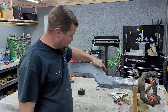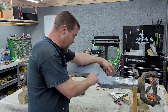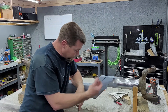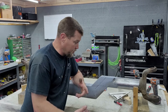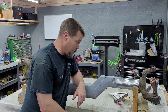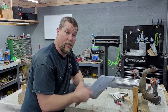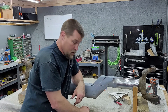If not, I'll make a new piece. It would be really nice if this would just fit like that and I can put a cap back over it. I'm not super thrilled about this because I had it the way that I wanted. I've built a lot of vehicles and this is the first time I've really run into everything being off-center like that. So I'm gonna drill a little hole right here so my plasma cutter won't blow back on me and mess my tip up, then I'll cut this back out along this line and we'll go from there.